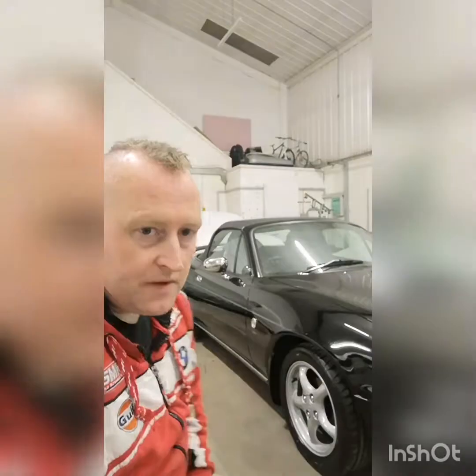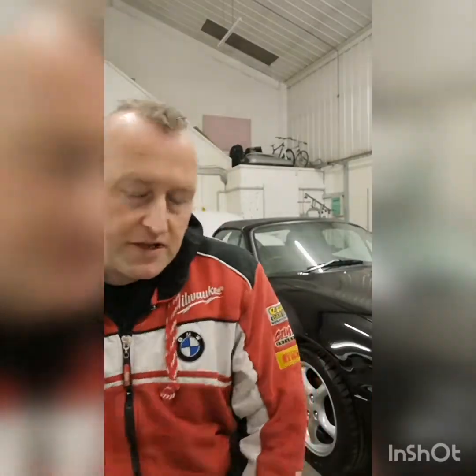This video is just a start to finish on a job we recently did on this Mazda that's behind me, Mazda MX5. So on this car we just did a deep wash, decontamination, detar, got it inside dried. We did multi-stage machine polish on it just to get rid of any swirl marks, any wash damage, anything like that. Panel wiped the whole thing down after polishing, and we treated it to ceramic coating on the wheels and ceramic coating on the paintwork, and the glass was just cleaned, exhaust tips polished, the usual odds and ends then to finish it off.